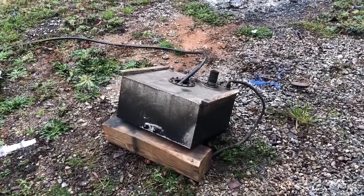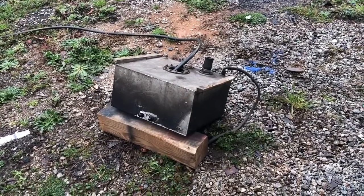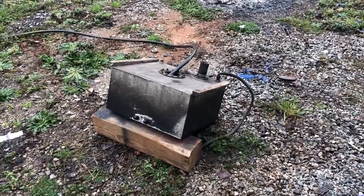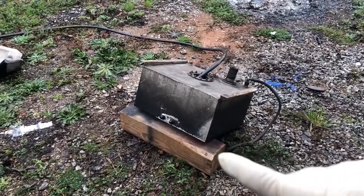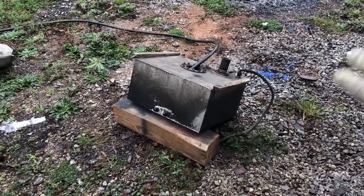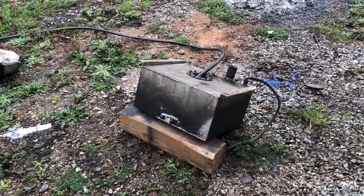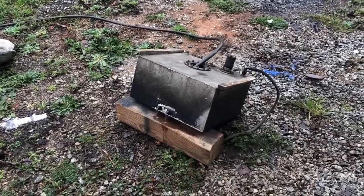So the tank is out of the truck and drained, but since we're going to be welding on it, we're going to go ahead and degas it. So what I've got is a water hose pumping water into it. I've got all of the ports and valves, everything open, and you'll see that I've got the drains up on an incline. Gasoline's lighter than water. As that thing fills up, I'm just able to scrub more of the walls before anything starts coming out, and the water level just now is getting to where it's running out.